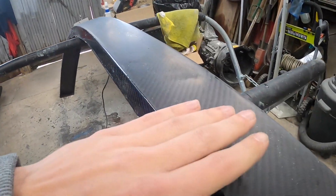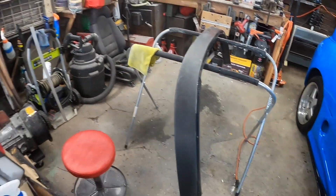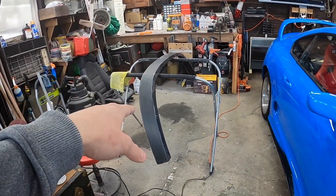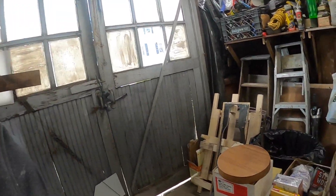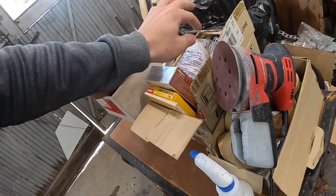You're going to see me in about 0.2 seconds because I gave it about three days to cure — gotta love the power of editing. I got that coat now sanded down, everything is nice and flush and smooth. Now what I'm going to do is go over this piece with 3000 — I already hit it with 1000, went up to 1500, now I'm going to do 3000 to finish it off, and then we're going to buff it. It would help if I had a mini rotary buffer like the Rupes company makes. I don't have one, so I'm going to have to use the DA, which makes it take much much longer.